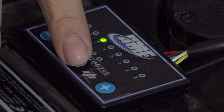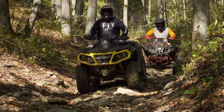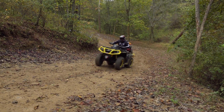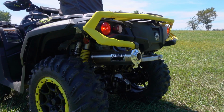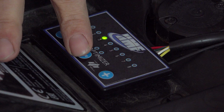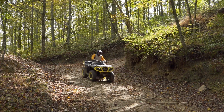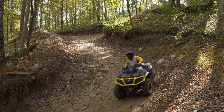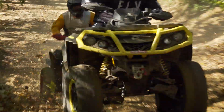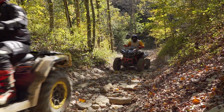We focused on the green, yellow, and red modes, modes 1, 2, and 3, which control fuel delivery at low, middle, and upper RPMs. HMF recommended settings of 3, 2, and 0, which seemed pretty close to ideal, but we wound up going up to 4 on mode 1, which further eliminated hints of sputtering and minor popping on deceleration. It also made the engine run noticeably cooler, both to our legs and in how much less the radiator fan was kicking on, especially in low-speed technical stuff.